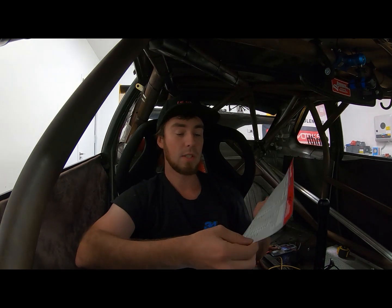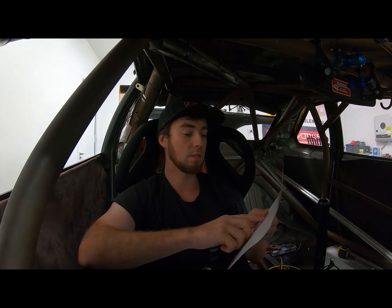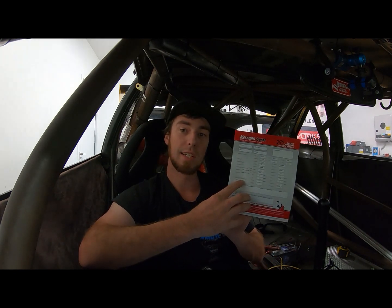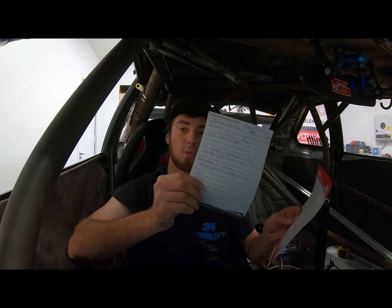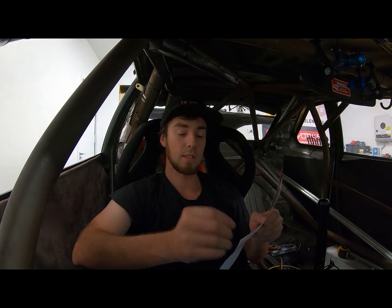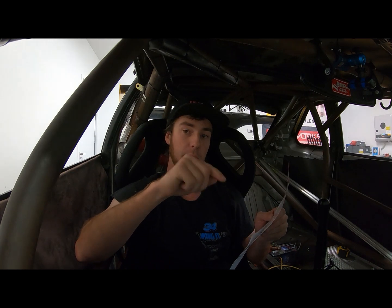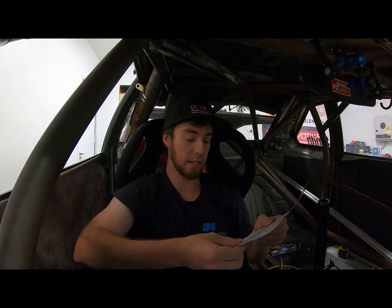Now, Doug kind of steered us in a different direction. Doug prefers using the center line of the cam. So it's actually got suggested center lines as well. I've got my sheet of running notes from while we were putting it together and doing the exhaust. Doug doesn't like doing it off the timing, because there can be a certain degree of error. If you don't have all of your valve clearances exactly where they're specified at cold, if it's slightly out, it can change by a degree or two, which was pretty evident when we did it.